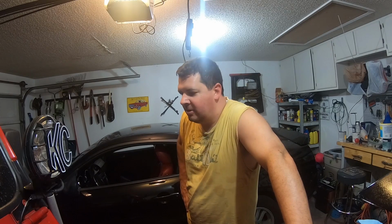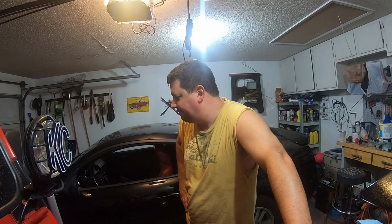Alright guys, so I got the car pulled back out of the garage, let it run for a little bit, revved the engine a little bit to heat it up, and the engine light came back on, same problem. The cooling fan never came back on. So I'm gonna call it quits for the night and do some research. Probably in the morning, go down to the dealership and see if I can get one of those gray brackets for the wires to connect into that goes in the bottom of the fuse box. That way, hopefully I can eliminate that issue, and maybe that'll fix the problem.